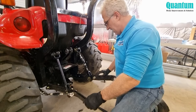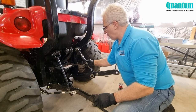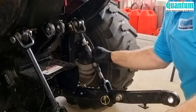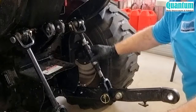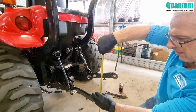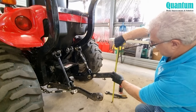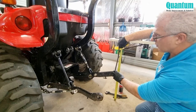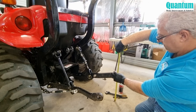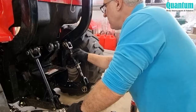You can see the height here — this one is roughly about 50mm higher than this point. I'm going to raise it by twisting this, so I'll loosen this nut and then turn it clockwise to raise it. Using a measuring tape: that one comes to 455mm, the other is 400mm, and that one is 460mm, so I'm going to lower it back a bit. It's very sensitive — falls very quickly. That's spot on — they're both the same height now. I'll just lock this nut back off so it doesn't come loose again.